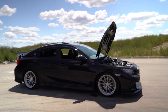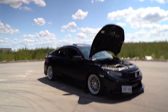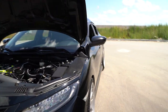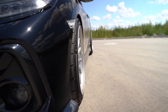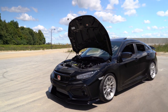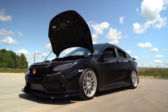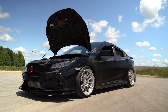I think the car is sitting super nice and super aggressive — there's not much more I would ask from the D2 suspension. It stiffens the ride just a bit, but nothing insanely bad. The fitment is perfect — you can just see that tire poking out just a little bit. This fitment guide I think is the best fitment for 18s on a 10th-gen Civic. Offsets can vary between probably 35 to 40 on 18 by 9.5, but you must run a 255-35 tire. These are the Firestone Indy 500s — a really good tire and one of the best bang-for-your-buck tires you can get.